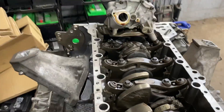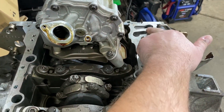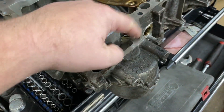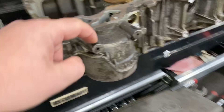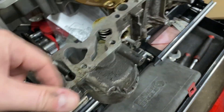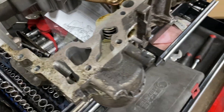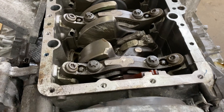That's the upper oil pan gasket — it's always leaking here. Here are the passages to the oil filter; there's a lot of pressure in here. The upper oil pan is upside down here. The common problem is with those passages because there's a lot of oil pressure — that's where the upper oil pan gasket leaks the most.